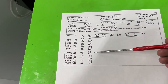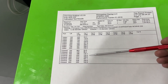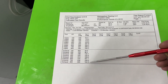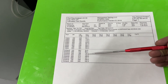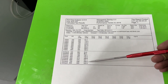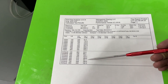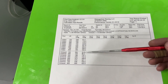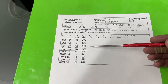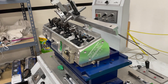The exhaust side is pretty pitiful — that ridge really hurt it. It's just not good: 400 lift is 154 CFM and peak is 193 CFM, which is pretty low. When you port these, the exhaust typically comes in at the 230s — so it's about 10 CFM down from a really nice exhaust port like the Dragon Slayer or the Profilers. You can make the intake port from 500 lift on match the Dragon Slayers and Profilers, just not at 400. It's still a really good head — so if you find one, work on it.